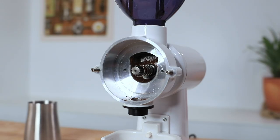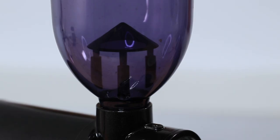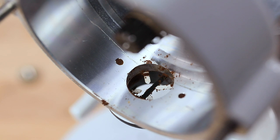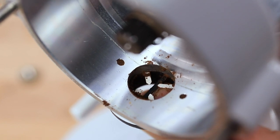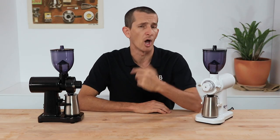Grinds retention was found to be fairly minimal — around two to three grams per grinder initially — then resolving to around half to one full gram after that, with the occasional extra gram in your dose every so often. The ghost burrs on the GS1 do take a little bit longer to grind through a full dose, and there was some popcorning of the beans in the hopper too. There was also some noticeable cleanup required on the GS1 due to static, though there is a clump crusher on each of these grinders that helps keep this from getting out of hand.